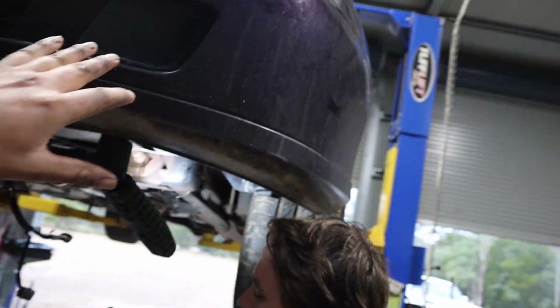I can't remember if I explained this already and filmed it, so I'm just going to go through it again. We got onto Harrop. Harrop do an OTR for that blower for the VE VF, but they don't do one for the earlier Commodores because they reckon it's too hard to keep it all under bonnet. It was just too much of a pain. So they don't offer any sort of OTR intake system that suits the blower on the engine in the car. In order to keep things neat and tidy, we decided we'd try and get a stock airbox off one of our donor Commodores that we've got around here, so we can put the stock airbox in, keeping everything under bonnet, nice and tidy and stock looking. Then from underneath in the airbox we can just stick in a K&N panel filter. It'll flow plenty enough, and from there we just want to try and get some ducting in through here.